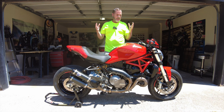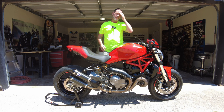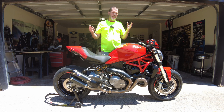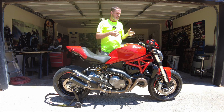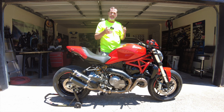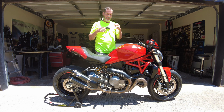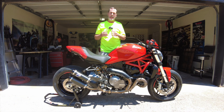My reasoning is the Ducati red coolant in this bike is almost like a sugary water — it's not as fluid as I want. And I can see I'm already starting to profusely sweat and I've only been out here about three minutes. This Ducati red coolant has created all kinds of problems in the winter: when it's cold and the cap is on normally, it bubbles out onto the floor when it gets down to 40s or 50s — it overflows. So in the winter I have to crack my cap when it's in the garage so it doesn't put that red sugary syrup on the ground. My mind's telling me I need better coolant — you can get Engine Ice for about 30 bucks.